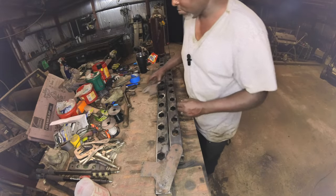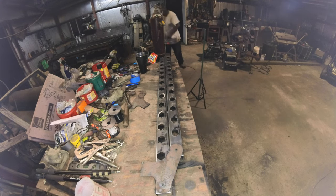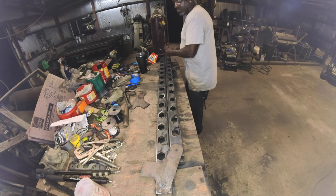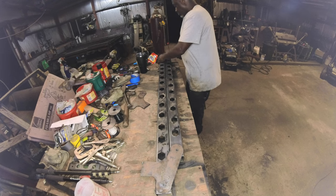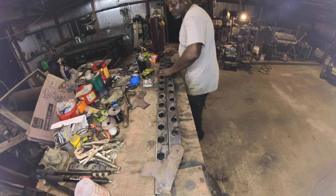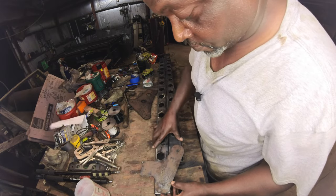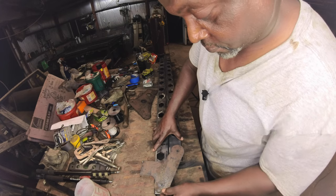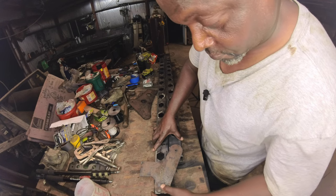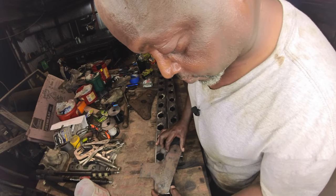I'm matching them up on the upper and lower control arm so I can match up the holes to see exactly where I need to put them so that when they operate, they operate correctly. What you see there is the lower connecting link — that's one side. These have not been put together yet as one assembly. I cut them out on the CNC plasma table and they're actually separate assemblies right now. Once I put them together, I'm going to weld them up so that they all match up and operate freely as one complete unit.